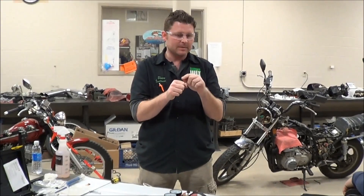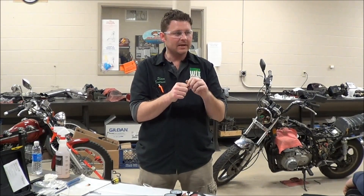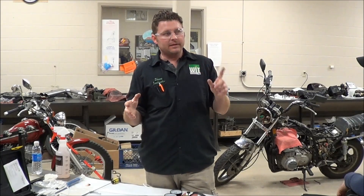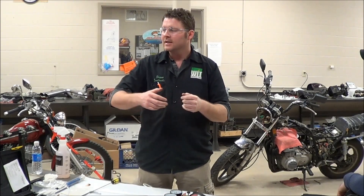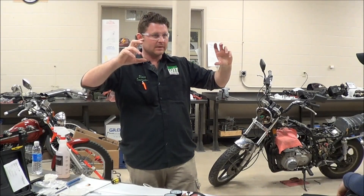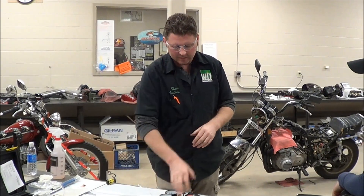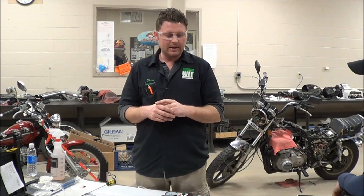A lot of times when you start taking your carbs apart on the adjuster screws, you notice there's like a paste — like a colored Loctite or a lock patch. That's because they're saying we already did it. The problem is when you take the carbs off and disassemble the rack, you 100% have to re-sync those carbs. The problem we've seen is that people are kind of careless how they store things — if you buy a set of carbs off the internet and they've been bounced and banged around, there's a chance the bodies or the plates are going to be tweaked a little. So with the tools available and knowing how to do this, we're just going to double-check it and make it good to go. This is part one of a multi-video series on how we're going to actually do carb sync.